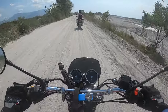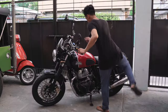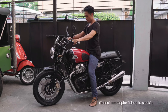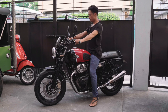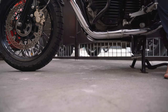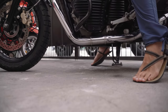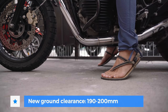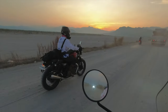All of which add up to an Interceptor that now rides like a dream. It handles easily yet it has the right amount of stability. Most notably, I got a significant increase in seat height — I suspect my Interceptor must be a candidate for the tallest Interceptor in the world. For reference, I'm 5'7" (169cm) and I am tiptoeing quite a bit now, whereas on a stock Interceptor I'm practically flat foot. From the stock ground clearance of 174mm, it's increased to somewhere between 190 and 200mm — the same as the tall KTM 390 Adventure, which is pretty awesome in terms of building an off-road capable Interceptor.